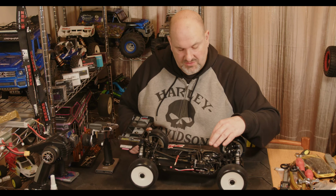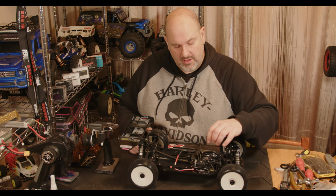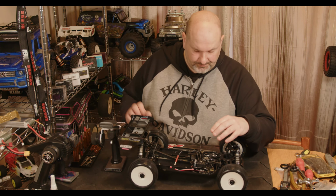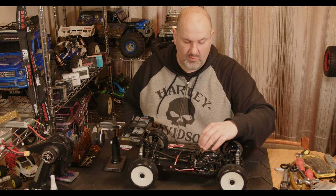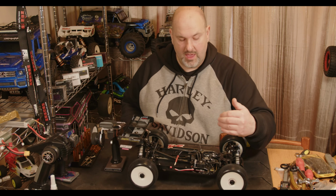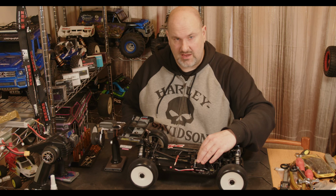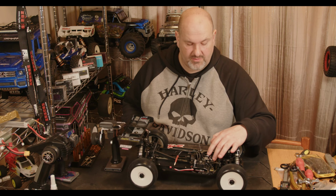But this receiver can set a different servo polling rate for the servo and the ESC. So this servo we can run at 800 or just above 800 Hertz polling rate with the Noble Pro, and it then lets me run the receiver at a different polling rate so the receiver can be compatible as well. If not, if we use the FGR4S, we've got to set it at 333 or whatever hertz the ESC can run at, and then we can't run the servo at the really high polling rate.